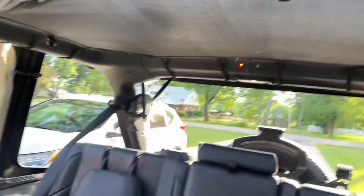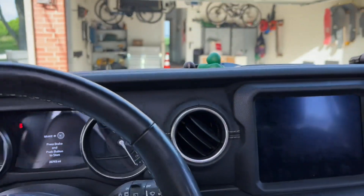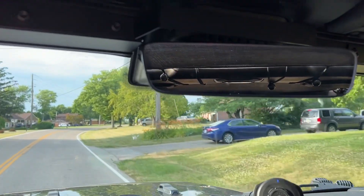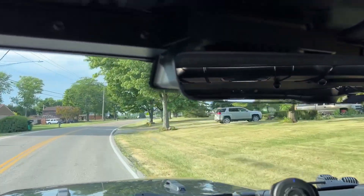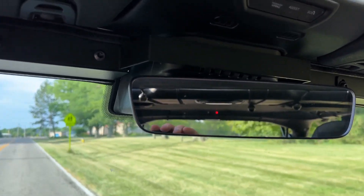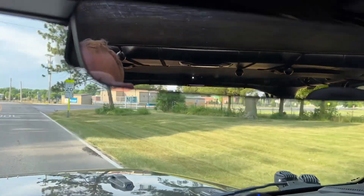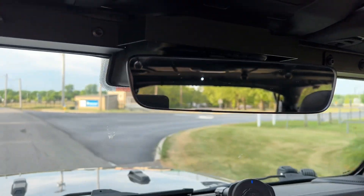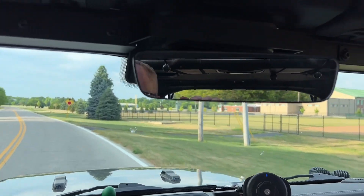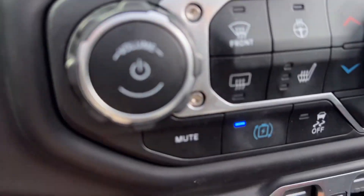The other thing that it does — of course when you put your foot on the brake, the red light comes on. Now you may be wondering why would I put them back there, why would I not put those indicators up here on the dash? Well, if I'm driving along and I let my foot off the accelerator, I can see that light come on in my rear view mirror, and if I reach over and hit my aux 3 button on, I can see that my reverse lights turn on. It's really double duty — anytime I'm driving along and using my rear view mirror, one of the things I wanted to know is am I signaling the way I think I'm signaling when I'm using max regen?